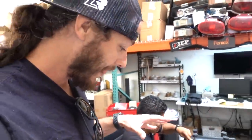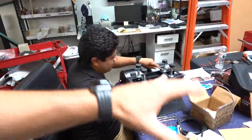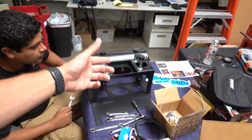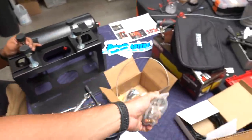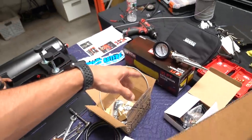So included in this kit — you basically have to piece some of this stuff together. You purchase your horns that you want and then they have different bracket options. Wes is actually showing up today to be swapping out the bracket on his truck. In my eyes I like his bracket setup better because it doesn't rely just on that little cable that holds your spare tire, which I'm assuming is gonna loosen up over time — Wes is actually bolted in. You buy your horn setup, buy your mount bracket that matches, and then you can buy the whole kit which comes with the tank, the compressor — it's a Viair compressor — and then he opted for an air chuck valve and a tire inflation kit.